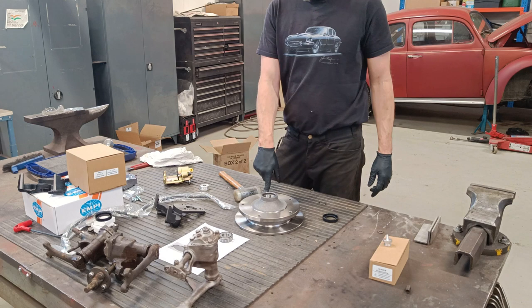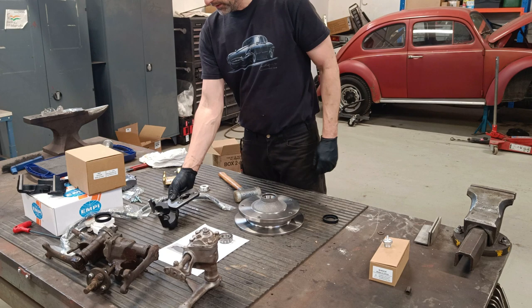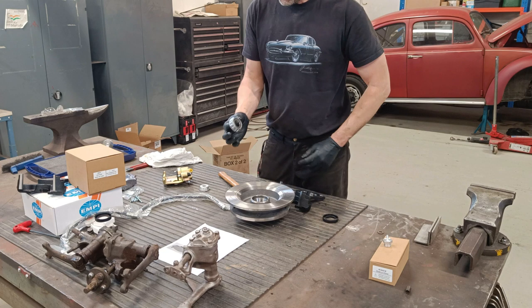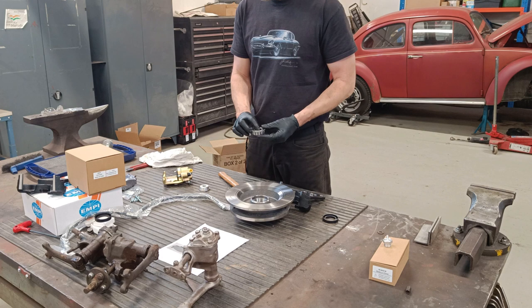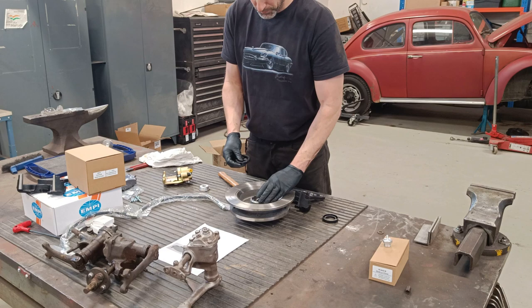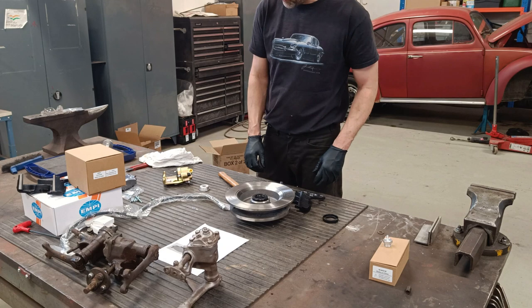I gave this a quick clean up with some brake cleaner. I will paint this outer piece but not right now — I'm just going to make sure this all goes together. I'll bolt this on using the original bolts, and I have to grease these first. You should grease these bearings before you put them in — pack the grease right inside of there. Then I'll put the dust shield on and lightly tap it with a nylon mallet.